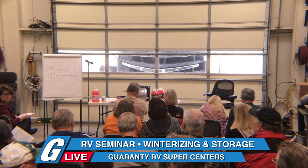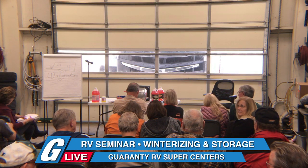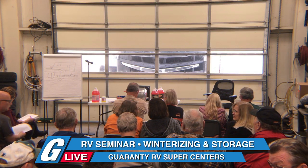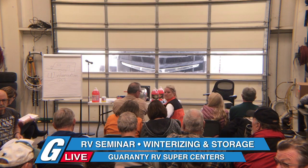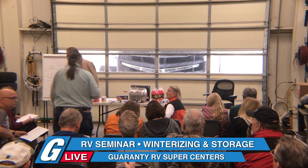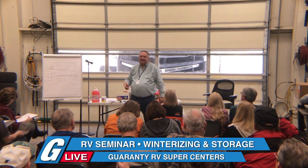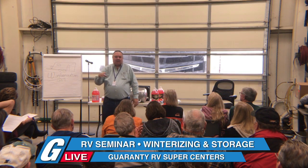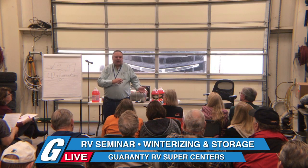After it's all blown out, put a quarter cup of antifreeze in each drain. Okay. Do I still need to put liquids in there on top of that, or should there not be any liquids at all in there after that? I'm getting to that. But your answer, the question is, it says in here, two-thirds of the way down, when you're done winterizing, put a cup of antifreeze down each drain.